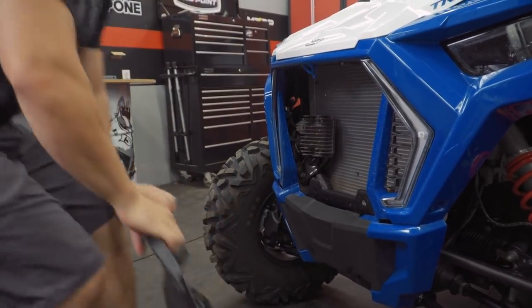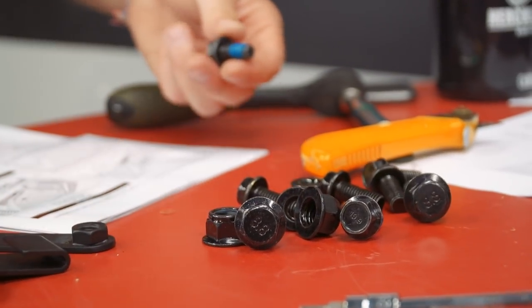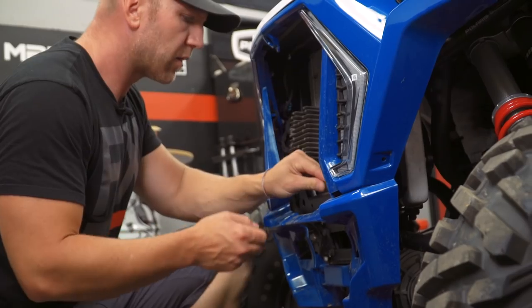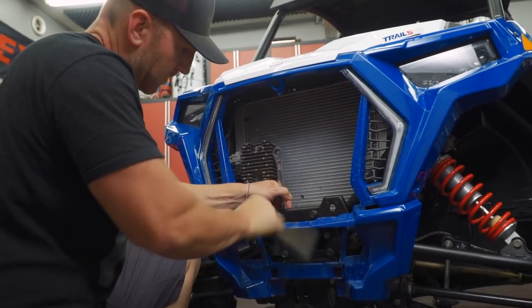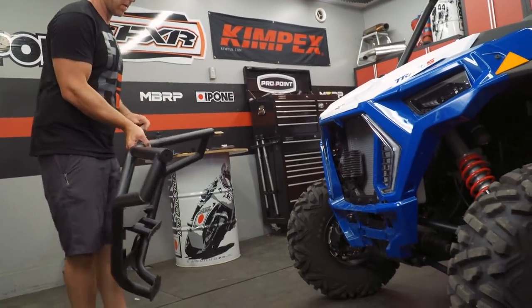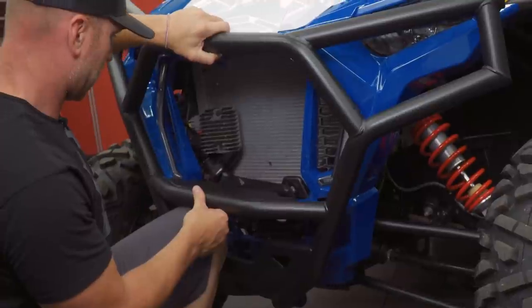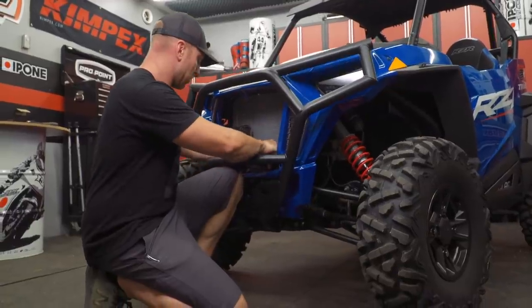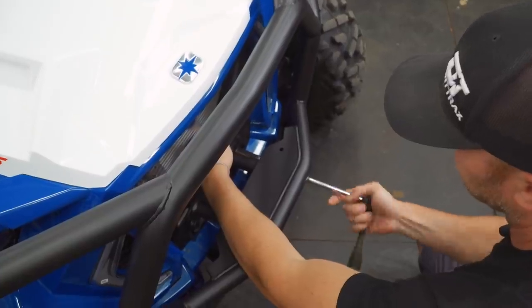This is called the high coverage bumper, and it's in matching black matte to the rock sliders, and likewise can be future fixed with the same paint. This bumper utilizes tall front headlight tubular surrounds that will act like limb lifters for any greenery that tries to get in your front end, and also covers all the way down past your grill, keeping your rad safe, and likewise down past the opening for the winch and fairlead. There are two mounts for cube lights, and the Polaris winches will work in conjunction with this bumper.